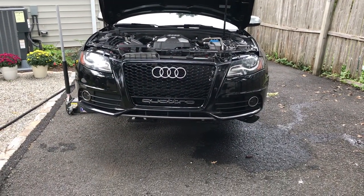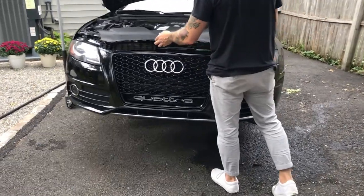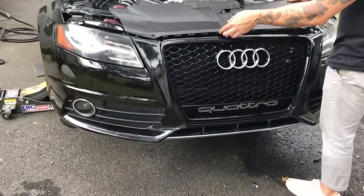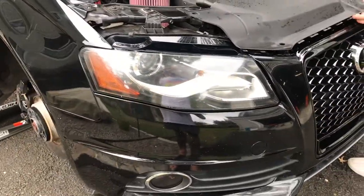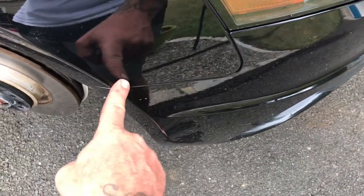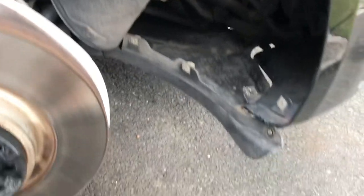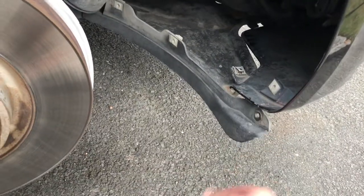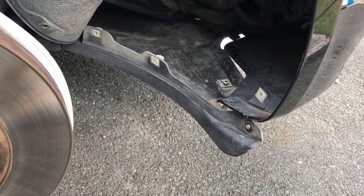Bumper's on, looking good and nice and clean. We painted that bumper black with rubberized undercoating material just so it won't get chipped by rocks. For reassembly you have three 10 millimeters - one, two, three - plus torx and clips all the way back around for your inner fender lining, and then you've got to button up your plastic protection plate underneath the car, and that should be it.